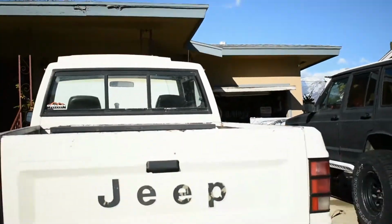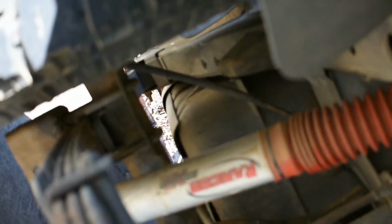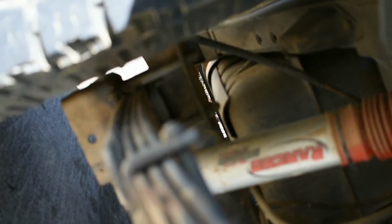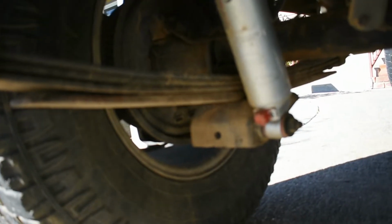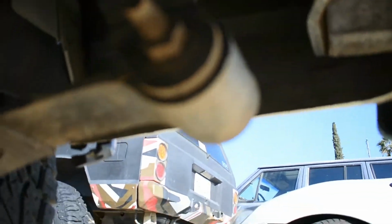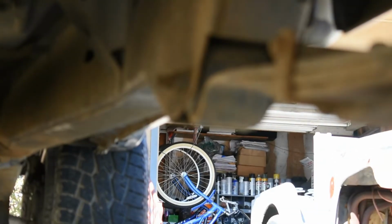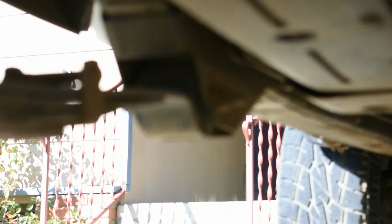But if you look underneath, for anything, but you know, so that's the leaf pack I'm saying has got a twist to it. All the U-bolts are where they need to be. Nothing looks like it's moved. Nothing's coming off of the pads. So like I was saying, it doesn't look like there's anything moved around or broken or whatever, but so that's been moved around. That bushing in there, that's hammered. That bushing over there, that one's hammered. That one's hammered.